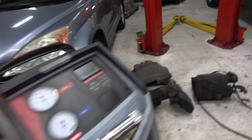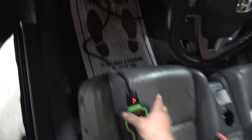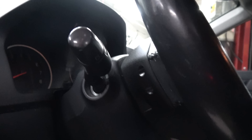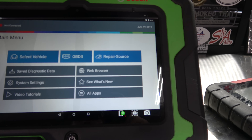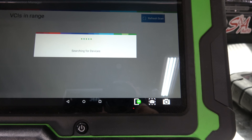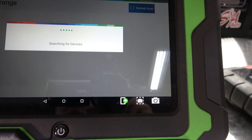They sent me the tool — full disclosure. It is a wireless scan tool. It is not a scope; there is no scope option on it, so we'll get into that in a minute. The dongle that comes with it is also a J-Box, so you can use this for programming with a laptop, not the tablet itself. Nobody supports Google for programming — you've got to use Windows.